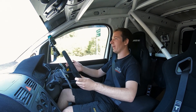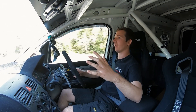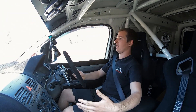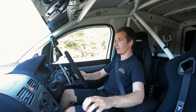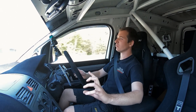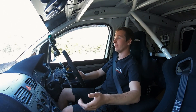So, the full spec: 28 turbo on our manifold, 3-inch downpipe, 3-inch exhaust. It's got the stage 2 solenoid injectors, CP3 pump — that's the stage 3 pump we've got. It's got the rail pressure sensor, new rail pressure regulator, ported head, cams, valve springs. It's got the coated pistons, machined for valve relief and slightly lower compression. ARP head bolts, ARP mains bolts. Lightened and balanced crank — this one's running the PD setup, so it's a PD crank, which is a bigger, heavier crank. H-beam rods, and everything's balanced as well.